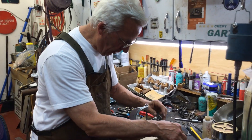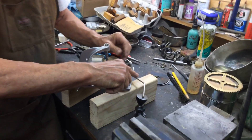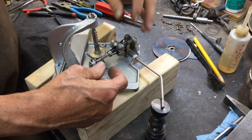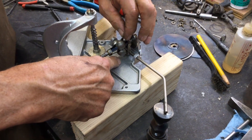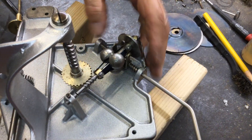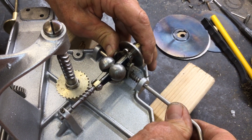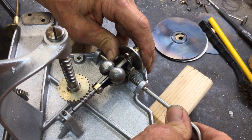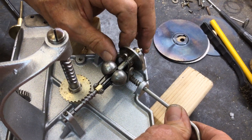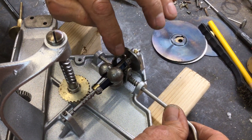Now, if you get all that popped into place, you have to jack up the speed control rod, find the slot that is in there, and come in and adjust it. I haven't adjusted it yet — you can see it's not hitting the flywheel dead center. But if you loosen it a little, you can move this over to get it dead center on the flywheel. The leather should be in line with the governor shaft like this.